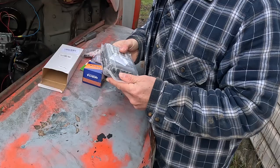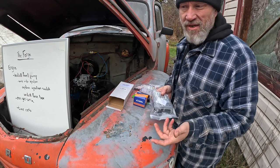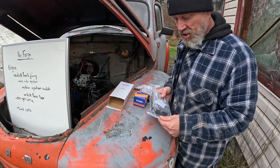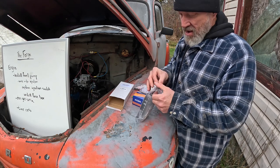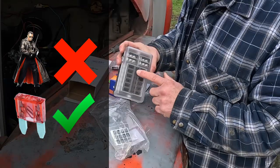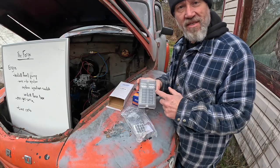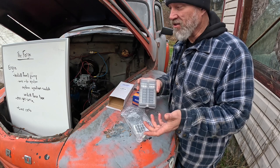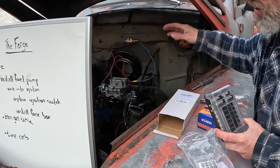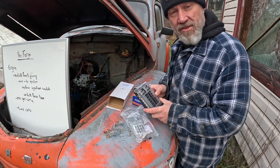The first item is the fuse block. I was thinking at first that I might need maybe four fuses for this vehicle — ignition, headlights, and stuff like that — but then I realized later on when I get this onto the Dodge 2500 I'm going to need more circuits, so I went and bought a 12-circuit fuse block. It's the blade style and has little LEDs that light up if a fuse is blown. I have a link to this in the description. I'll probably mount it inside the cab somewhere because of dampness in the engine bay.